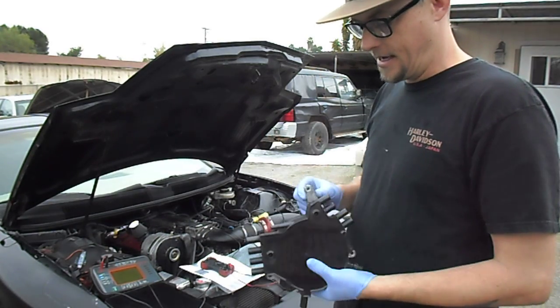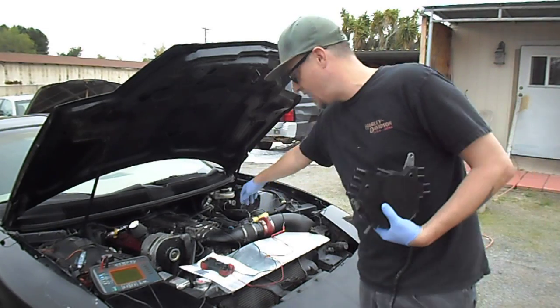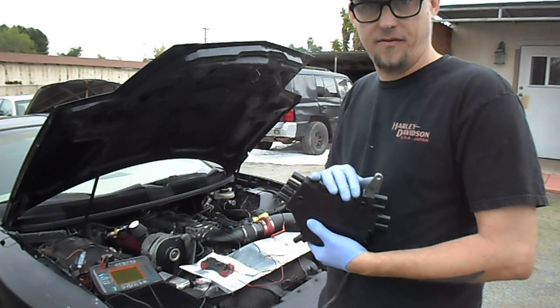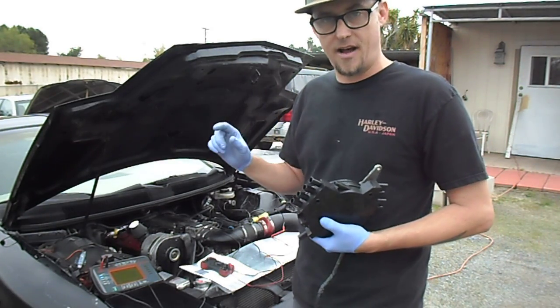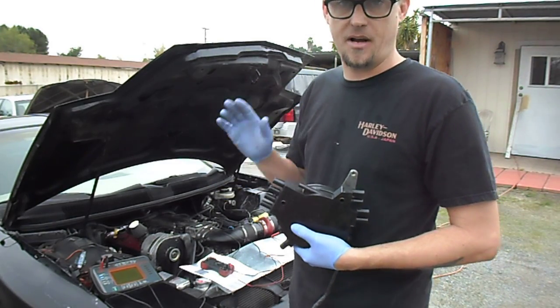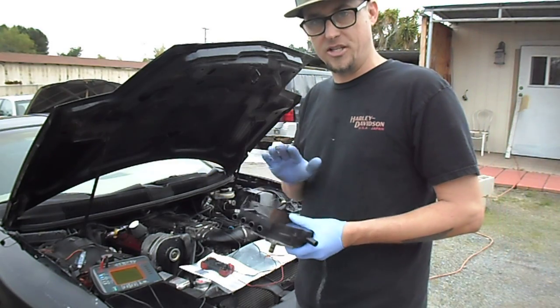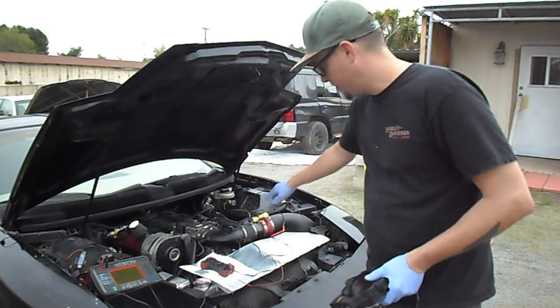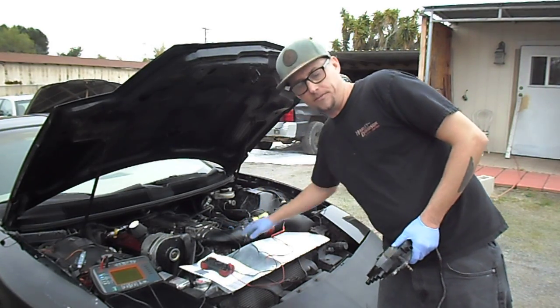This is the vented OptiSpark. Here are the vents — one goes to the intake manifold and the other comes to the elbow. They're very crucial to a long life for the OptiSpark. There are two check valves on the intake side and those go bad all the time. I recommend replacing them — I got two check valves at AutoZone for six bucks. With the engine running, the vacuum line going to the snorkel needs to pull vacuum at idle.